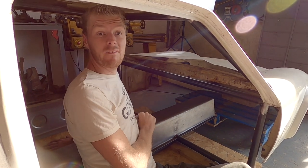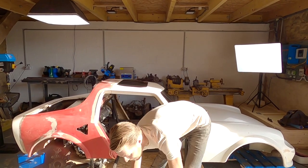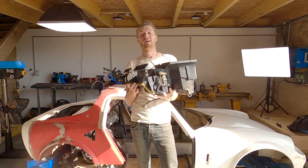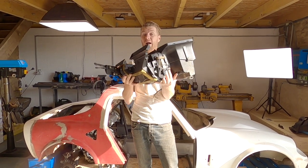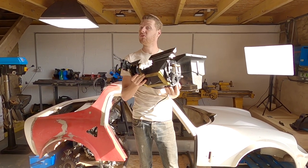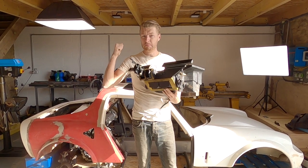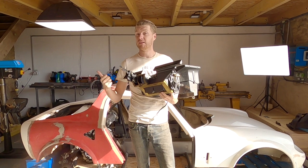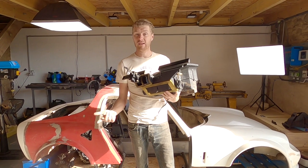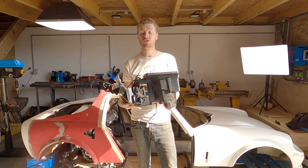And I have the heater right here. Italian car fans amongst you may be familiar with this. This is a heater from an original Fiat Panda. Now, my reasons for using a Panda heater over any other sort of heater are quite simple. I didn't want something that was massively complicated and electronically controlled, because that adds wiring, complication and weight. I didn't want air conditioning, and I wanted a completely self-contained unit.